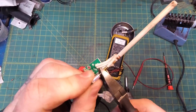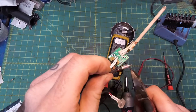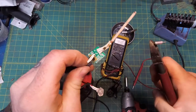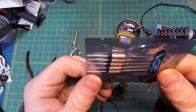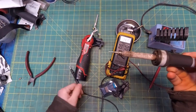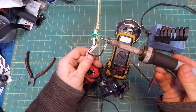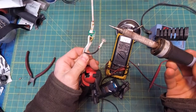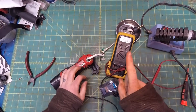Here's the fuse crimped in line. To replace it, you'll need a 125 degrees C rated 15 amp thermal fuse. I used one rated for 142 degrees C because I'm a total badass — also because there were no 125 degrees C fuses on Amazon Prime. The challenge with soldering is obvious: the heat from the iron has to heat the leads up enough to melt the solder to tin it, but that's just gonna conduct into the fuse and blow it right away. That's why they crimp it from the factory, but I have a plan.